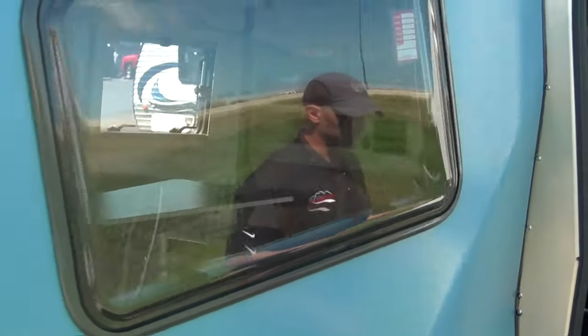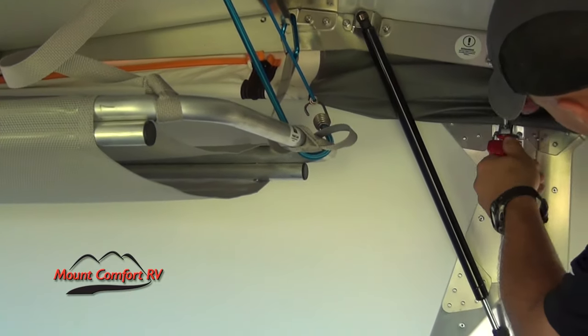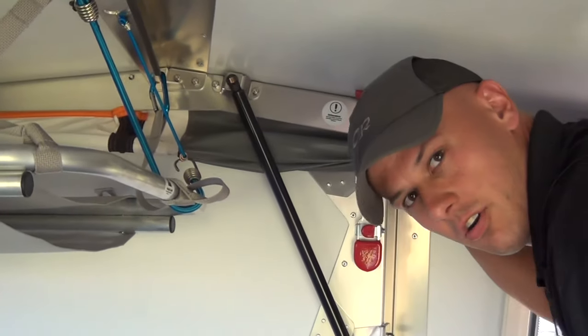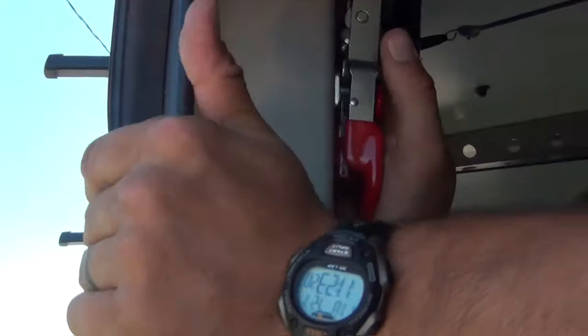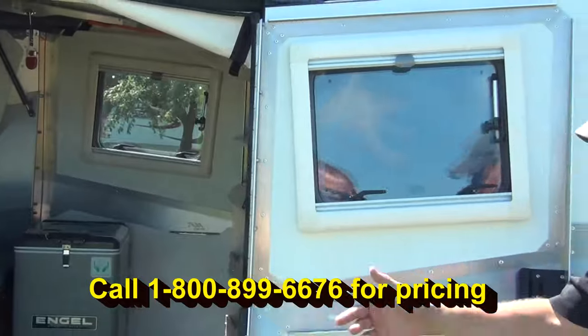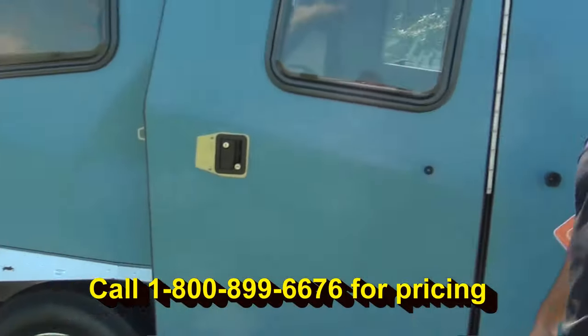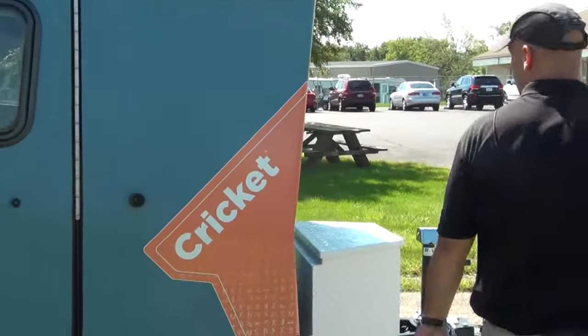Now that your outside is locked up nice and tight, go to the inside. Right here you see the one where we had locked and it came out simply because we brought it down — put it back in there. Just make sure you don't pinch any of your vinyl here, push it down hard, lock it into place. Do the same thing over here. That's it — close your door, bring up your back jacks, move any wood blocks you have, and you're ready to go.